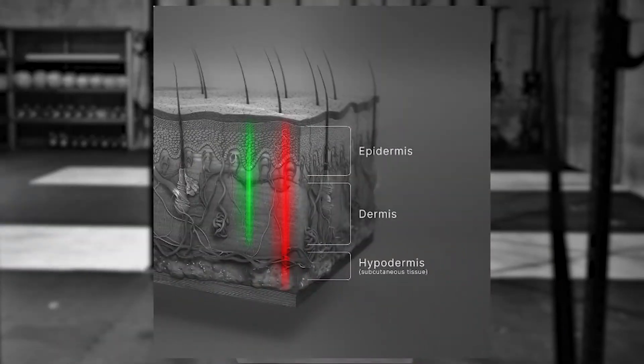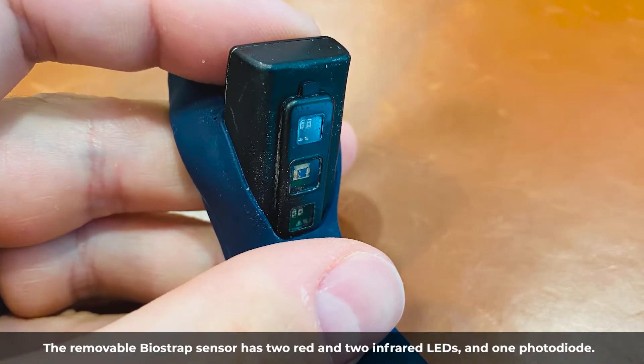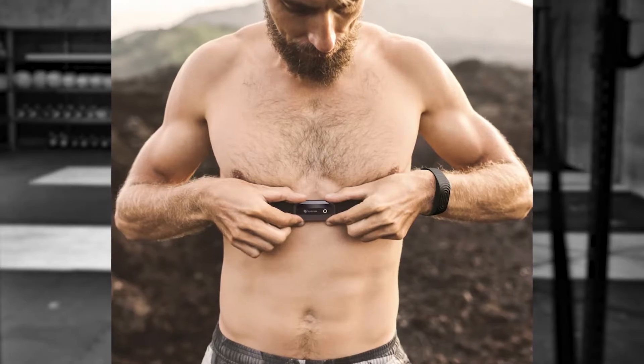Whoop uses a combination of both — during the day it uses the green LEDs, which you can see on the device. BioStrap, on the other hand, uses red and infrared LEDs exclusively. That already separates the two products, because BioStrap is not very good at capturing activity. If you work out and want to measure heart rate during workouts, red LEDs are not ideal due to too much motion-induced noise. That's why BioStrap supports third-party chest straps to capture heart rate during workouts, effectively requiring two sensors — one on the wrist for sleep and one on the chest for activity.